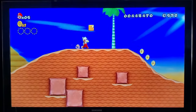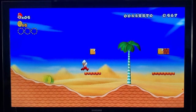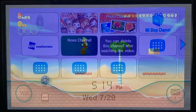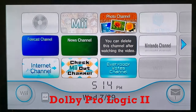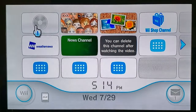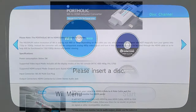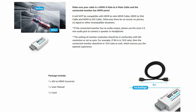After setting up the device, make sure to change the aspect ratio to widescreen settings — 16:9. Just go to video settings in your Wii. You'll also want to set your surround sound settings to Dolby Pro Logic 2. Adjust your television to stretch the newly configured widescreen video across the screen. And lastly, if you're using a surround sound system, engage Dolby Pro Logic 2 decoding for surround sound effect in supported games.